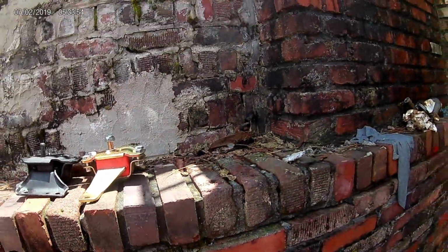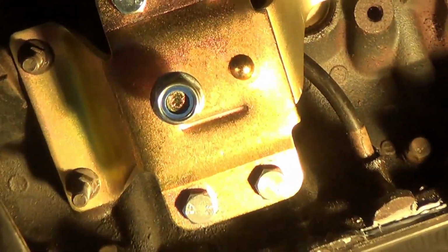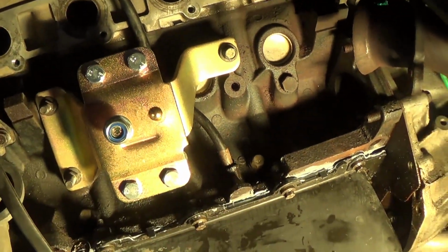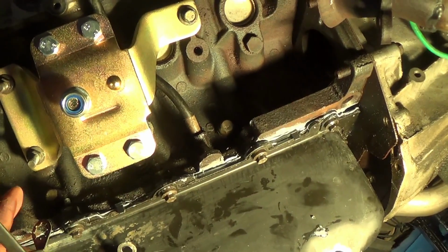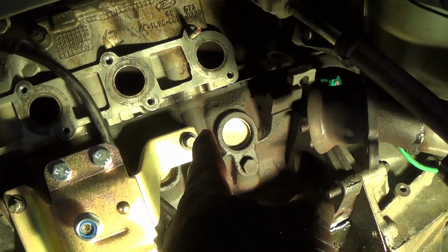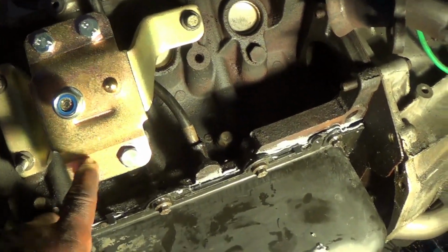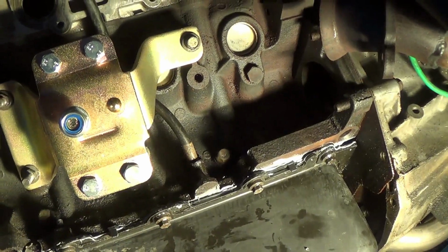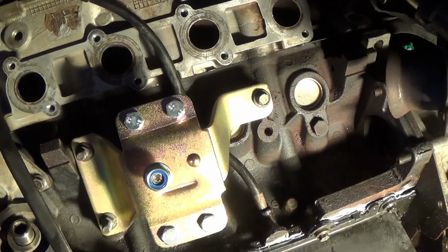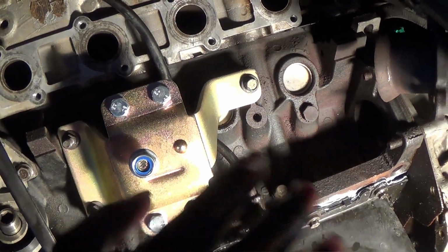So let's get back. Okay, family, I can see that I do have the new motor mounts on this side. I gotta do the other side, which is basically simple, same thing. As I always say, tighten up the bolts right here, go across right here, tighten up that bolt, then come back to there and then tighten them all down. The supports right here, I had to tighten these down because the other ones had bolts already in them that you couldn't move. So I had to tighten these 4 bolts down first, and then put it on her.